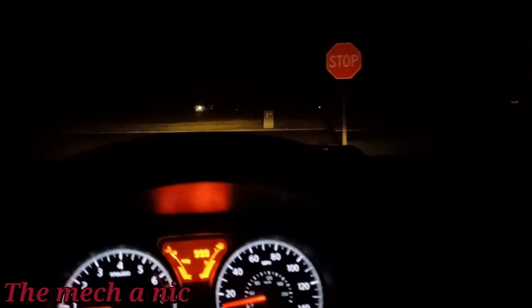Start off at 5 miles per hour and then slowly ramp it up as everything feels fine. As you start to build up more confidence in the car, then start to drive it a little bit quicker. I'm not saying to go speeding or anything. I'm just saying start to apply a little bit more pressure to your brake pedal. Now let's just say one of your bleeder valves were to fail because you didn't fully tighten it down. You rolling past a stop sign isn't the worst thing that could happen. You don't want to be on your daily commute and end up rear-ending someone or flying past a red light because your bleed valve is leaking because you didn't fully tighten it down. So a thorough test drive is highly recommended.